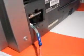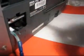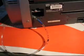You can actually see on this printer here, if you look in here, if I put the screwdriver, I don't know if you'll be able to see that, there is the pad that gets all the excess ink, and it's absolutely sodden with ink. Okay, so what I've done now is just cut this tube to length, because we're going to have it in a little bottle just here. You can already see we're starting to see the waste ink come down the pipe.